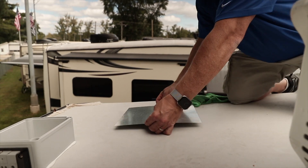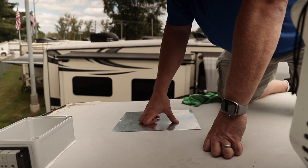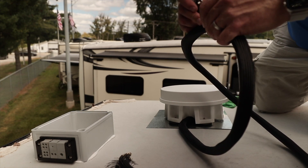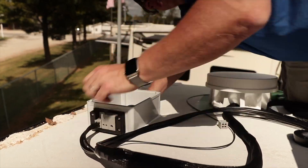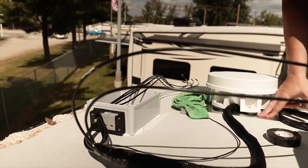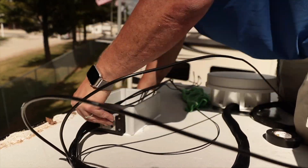For the antenna, we placed a magnet mount-based antenna on a galvanized steel plate right next to the box — far enough away from the AC unit and well-placed. If it ever needs to be changed out in the future, it's just stuck with a magnet, so we can easily remove it and swap for any future antenna. This is a dual-rated 5G antenna. Once the box is in place with dicor all around it, we start fishing the cables through the IcoTech system — it looks so nice and clean, and every grommet is designed specifically for that type and thickness of cable. We have full bundles of these on our site if you're looking for something like that.